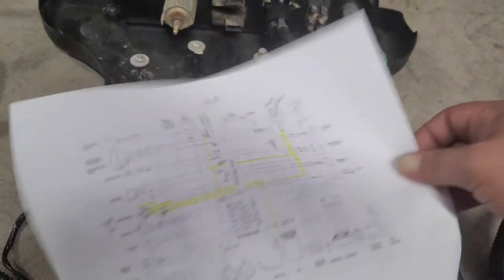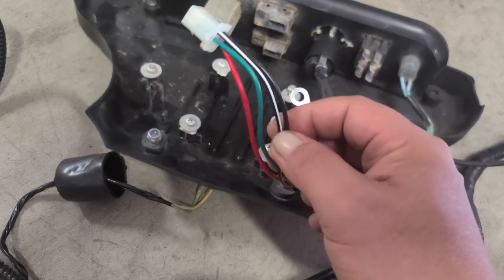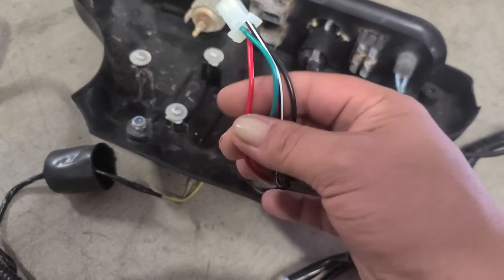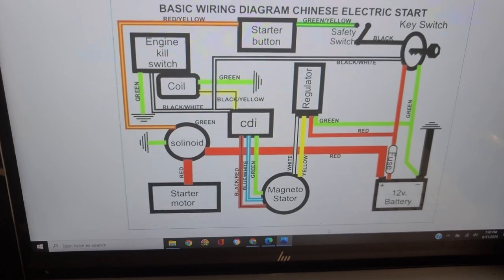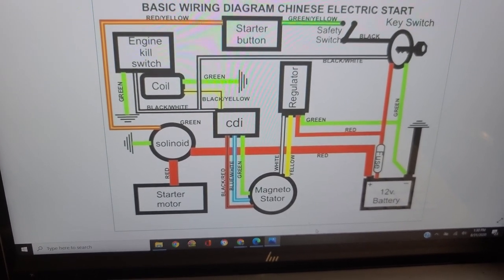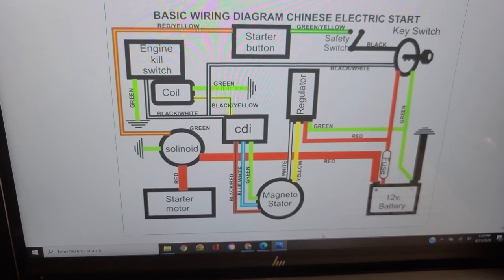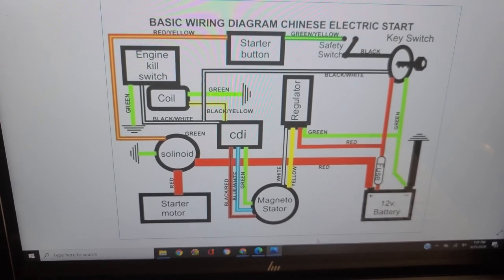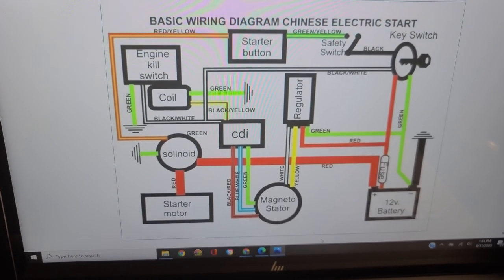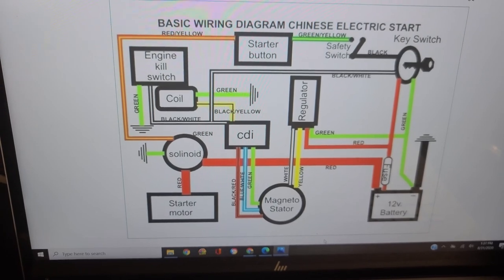Now when it comes to my ignition, I'm going to have to get the pin out for this style ignition switch and find out what color they are making the yellow red — which I believe is going to be red but I could be mistaken. I was able to find the four wire key switch diagram. So if we look at the key switch, there's a black wire, black white, red, and green, and this shows exactly where they go. I hope this helps out — I know z-lock has been waiting for me to help him with the ignition wiring. I'll leave a link in the description below.